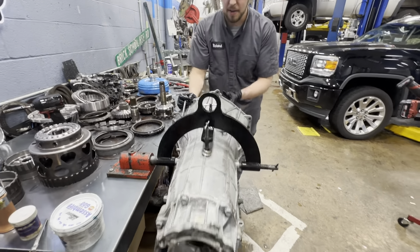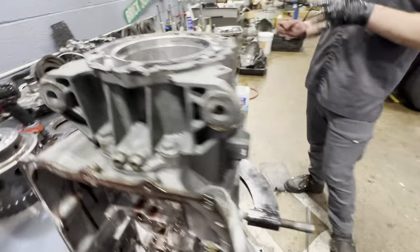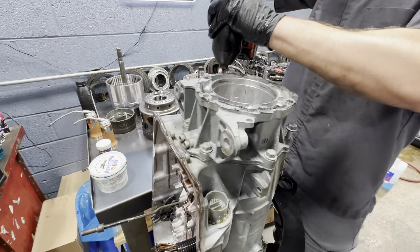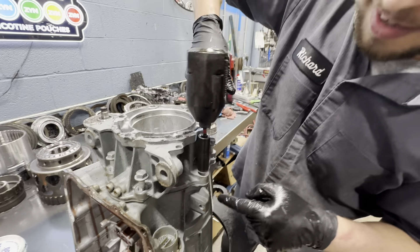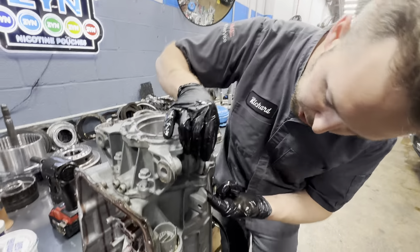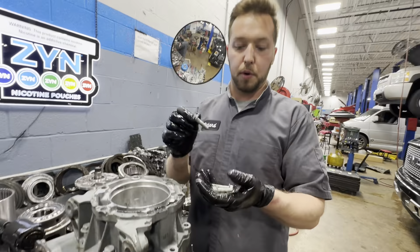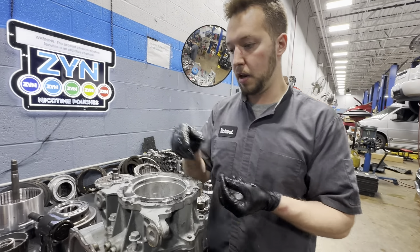What we'll do now is go ahead and take the adapter housing off. They spray painted this with some funky gray — I don't really like that color. Go ahead and blast these off. This one bolt is always going to fight you — this bolt is the only bolt in this transmission that actually goes through and is exposed to atmospheric conditions, so rust, water, and salt. Obviously this truck is from New Jersey, but even on Maryland or northeastern trucks that one bolt on the case extension is always tighter. You have to clean the threads before you go back in.